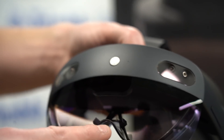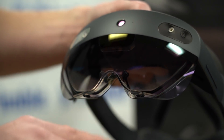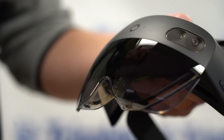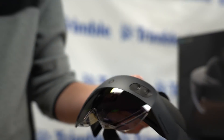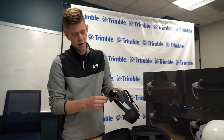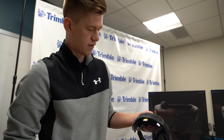You can see new on this HoloLens the two rear-facing eye tracking cameras. Those are being used for eye tracking so it knows where you're looking in the holographic world. But it's also allowing you to do authentication based off of your iris, and it automatically calibrates the device to every person that puts it on. The old HoloLens, you had to know your IPD — your inter-pupillary distance. This one will automatically customize and tailor it to every person that puts it on their head.